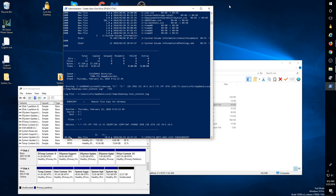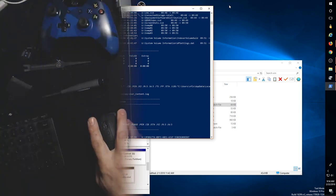In this particular video, this was a brand new Xbox One X that I opened up and already booted up. I already have my Xbox One X account added to it, and that's also important. You want to make sure you boot it up, get your account added, install some games if you want — although it will make the copy process take a little bit longer. But the system has to be up and running. So I skipped showing you that, but just know this system was running. We're just upgrading it to 5TB, and I'm showing you the quickest way to get there.